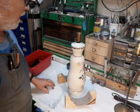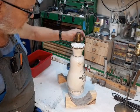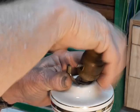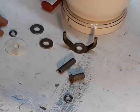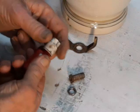Besides getting old and wearing out, the most common problem with this type of lamp design is that it gets loose, and there's just no practical way to tighten the parts up. You can usually get it apart by putting a little tension on the saddle, which will put the pipe in a bind, and then they'll unscrew. This cord's already been cut on this one, and the little short pipe will fall out the bottom. I'm going to put it back together with a slightly longer piece of pipe because I'm going to be adding a few things to keep it from ever coming loose again.